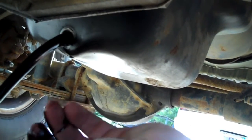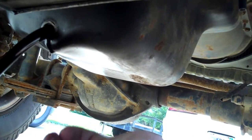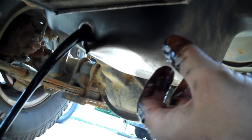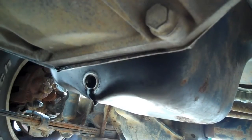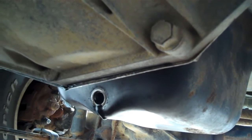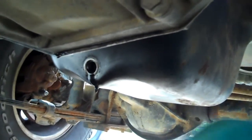I could lay here and watch the drain and that would be absolutely no fun — and I'm sure the video wouldn't be fun to watch on YouTube either. So I'll catch you guys in a moment once the oil drains out and we'll move on to the next step. Now the oil is pretty much drained out of the oil pan. You really want to be patient before you replace the drain plug — make sure it stops draining. Wipe the area clean.